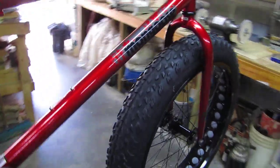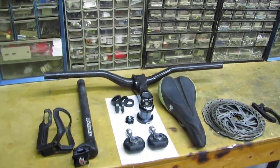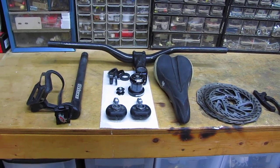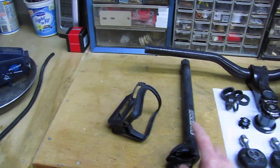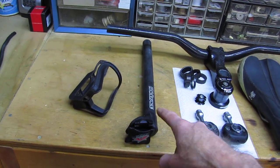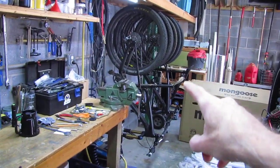I've been doing bike repair for many, many years and I went through my parts drawer and found a bunch of really super light replacements I already had. I have a specialized bottle cage — though I'm not sure what will fit properly after the battery goes on the frame. I also have a nice Race Face seat post, but it's 27.2mm and the frame is 28.6mm, so I ordered a 27.2-to-28.6 shim so I can use this seat post.